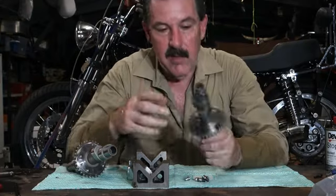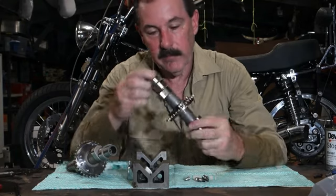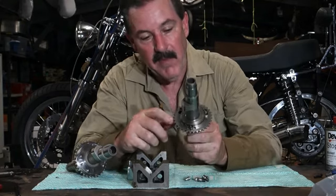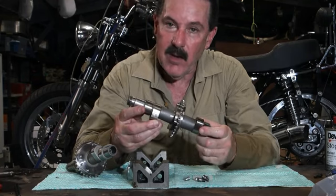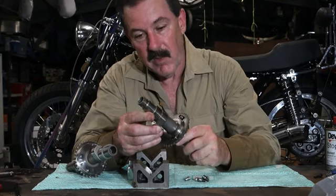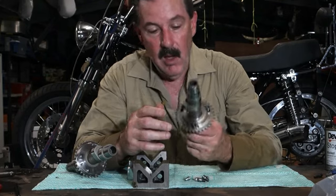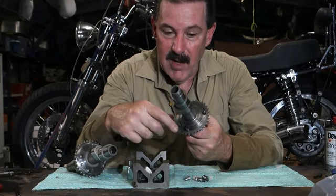I've been degreeing my cam in over the last little while, and this is the cam. I have 3 of these. They're all the same. They're a Megacycle 250-30. Not that that matters, but that's what it is. And I also had the sprocket modified to be adjustable.